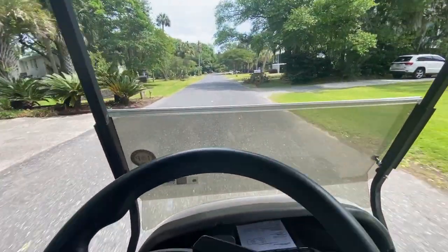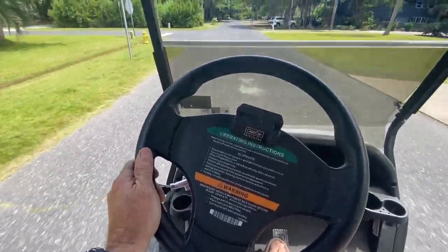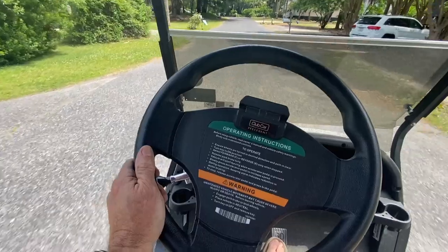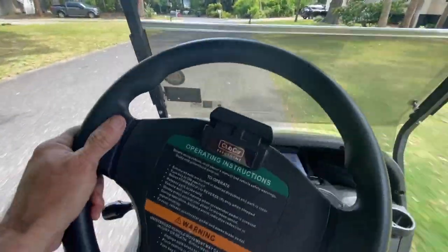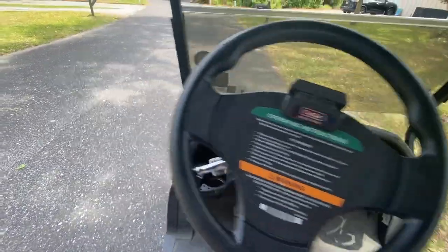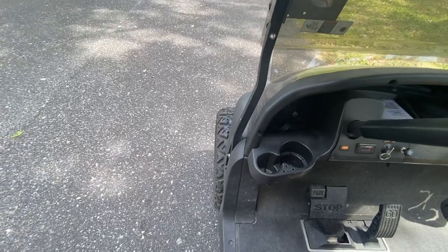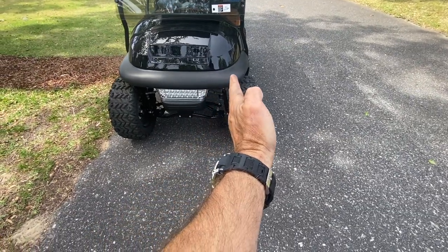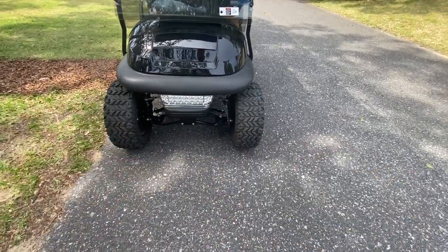Going on the first test drive. No traffic, so I'm right in the middle of the road. As I'm going straight you can see how off my steering wheel is. I'm going to pull over in a safe place to show you how we're going to straighten that out. So this is where my steering wheel is, but yet my tires are going straight down the road. If I straighten the steering wheel out to the left, watch that left tire — you see how it comes over. We're going to take our 12 millimeter. I actually had to pull the wheels out this way, which means they need to come to the passenger side.